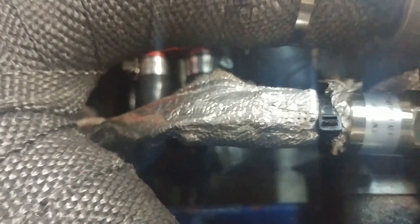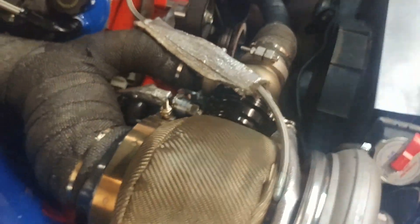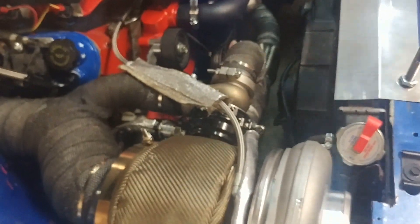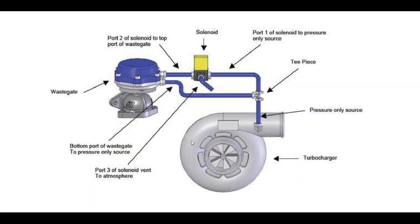On the other side of the top of my wastegate I have a Low Dollar Motorsports zero-to-50 PSI dome pressure transducer, wired with a heat shield into the Holley. There's the five-volt reference, the sensor wire, and the sensor ground. The five-volt and the ground are wired straight into the power tap off of the Holley harness, and the signal wire goes to an input.